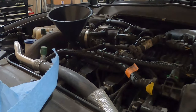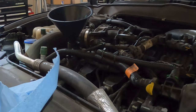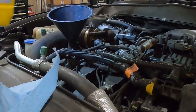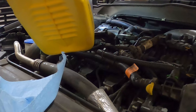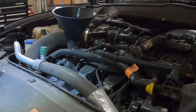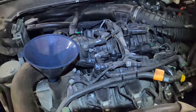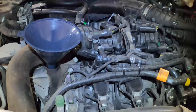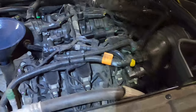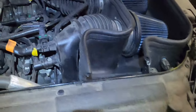Then you're going to grab your oil and just let it rip. And if you're like me and you have horrible crippling anxiety, you're going to want to check about 150 times that there's no oil draining out of the engine block from the drain plug that you literally just put in on camera. And there's not. So we're going to let that sit for a minute, then put the dipstick back in, put the cap back in, start her up, pull her off, let it drain down, and put the rest of the oil that it needs in it.